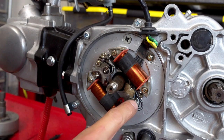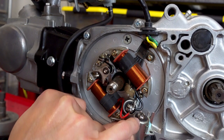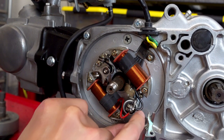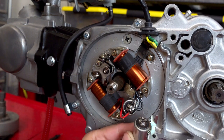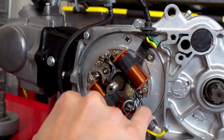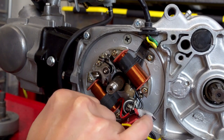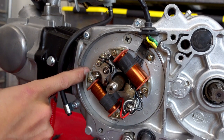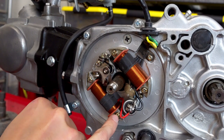A couple of things I tried while troubleshooting: on the coil itself, make sure the lead coming off of it — when it's new there's a waxy film on it that you need to use a razor blade to scrape off. Leaving that waxy film on has the potential to not create a good connection. Also, when soldering onto the condenser there are little tabs that fold over on top — those aren't what you solder directly to. You need a good solder connection right on the top like a battery. Also, there seemed to be some type of wax or grease on all of the coil surfaces, so use sandpaper to sand those off so you've got a good grounding to the stator plate. Make sure your stator plate is really clean too.